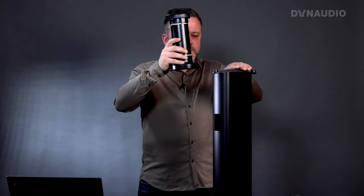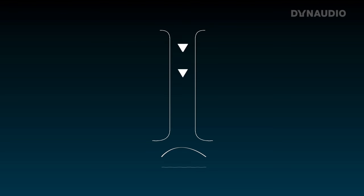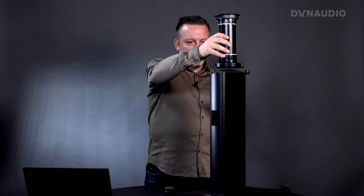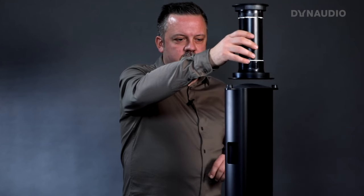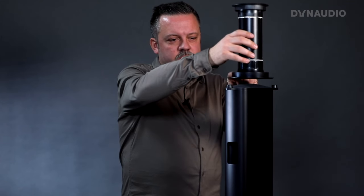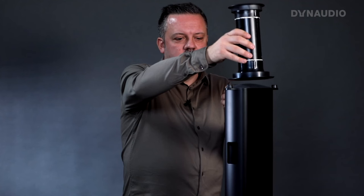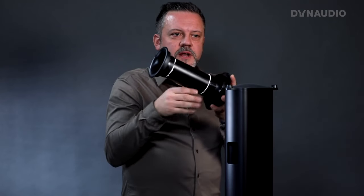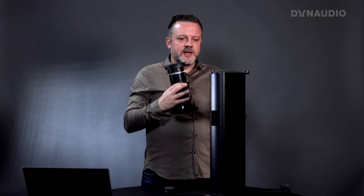So what we did is create a soft surface on top of the stand, so that when the port is sitting right on top of it, the air is evenly spread out and doesn't hit a hard edge, which results in less port noise. One other very clever aspect of this design is that the height of this space is actually calculated so that the effective exit of the port is now on the side, between the port and the stand itself. That extra distance of a few centimeters is calculated as part of the port length, which defines the tuning frequency. That's why the stand is actually a calculated part of the port tuning.